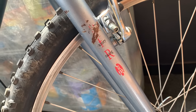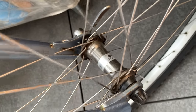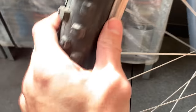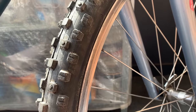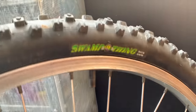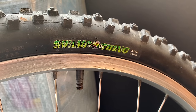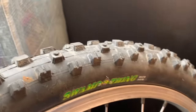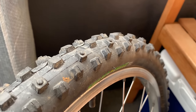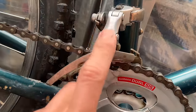Made of chromoly — pretty sick. Got these radial rims and STX hubs. The rims are actually pretty worn down and I don't know if I'm going to replace them or run them, but we'll see. The tires are Maxxis Swamp Things, 26 by 2.1 — they look a little bit thinner, maybe 2.0s, but the logo is pretty cool with the little monster coming out. That's pretty rad. 35-65 PSI and the knobs are pretty aggressive — probably a mud type tire. There's a bottle cage in pretty good condition.